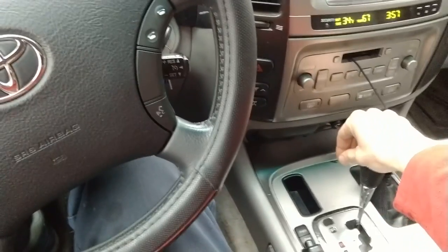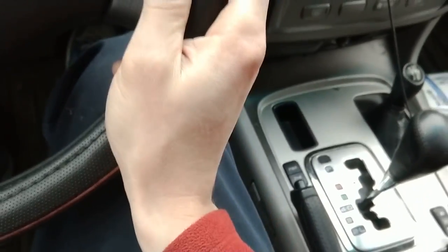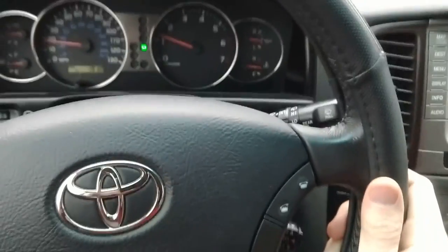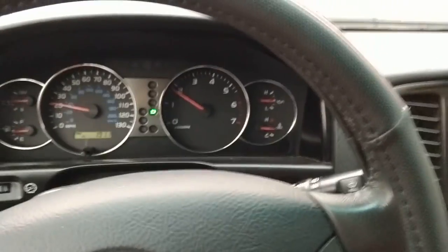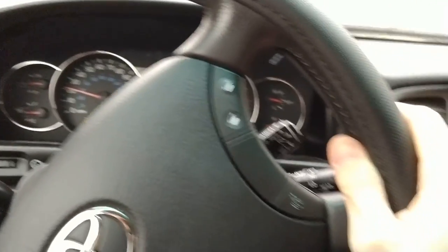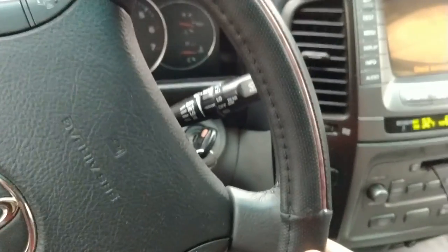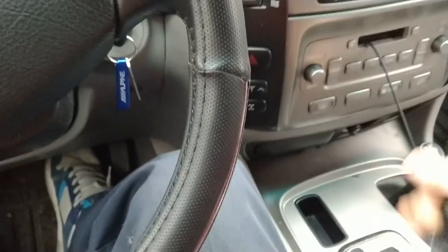Now here's the moment of truth. When I go into drive — that's actually a huge difference. There was no clunk. When I was going from park to drive before, it would make a big thud that was audible and I could feel it. Now I'm going to accelerate and let off, then get on again. Definitely a huge improvement — that's 95% cured. Basically what was happening was when I would accelerate and let off the gas and get back on it, there was another thud — some play in those drive shafts. We have since remedied that situation by lubricating the drive shaft, and now it's slick.